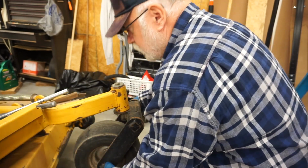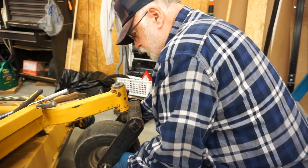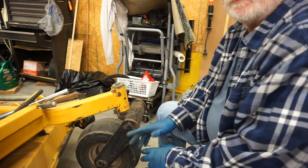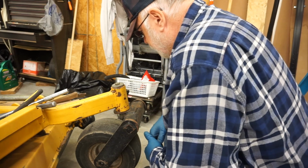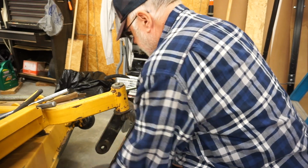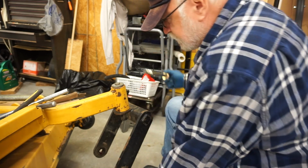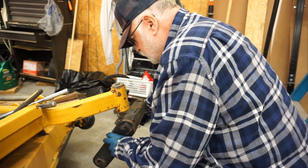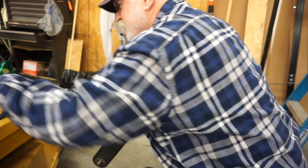Okay, we're going to take off this washer. Put it right there. It's up there for the time being. We're going to push this bolt through. And I don't believe these are greasable bearings, but someone has been stuffing bearing grease inside that one. And looking down through here, it looks like they've been doing the same thing with this one. So let's just take a look and see if that's the situation. Well, no, you know what? This one is a greasable bearing because it has a grease zerk on it. So it is greasable, or at least it has a grease zerk.